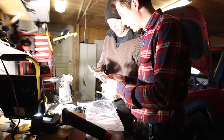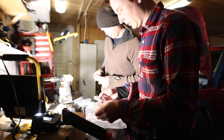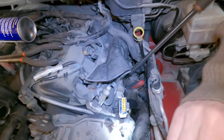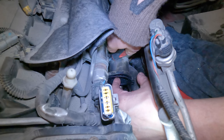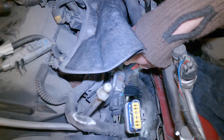Well, the gaskets are the same on both sides. They're just a different way, maybe. And I also went for four new clamps because you don't know if they're going to break or not. Just quickly use the rag to clean off the end of the cooler, and then put on the gasket. So we left in the bolt, or Erik left in the bolt, with the ratchet on. This way we can hook up the new gasket. Then we need our EGR valve.